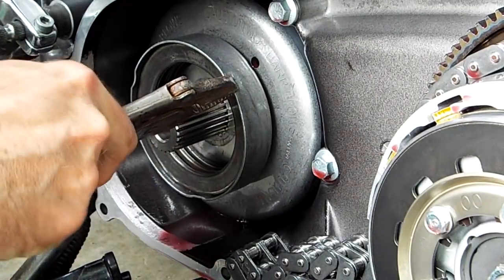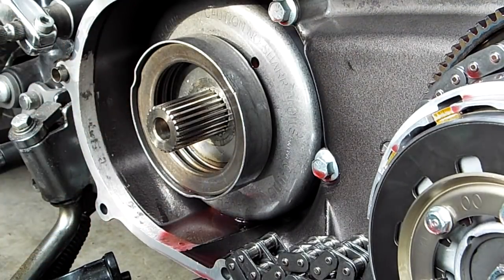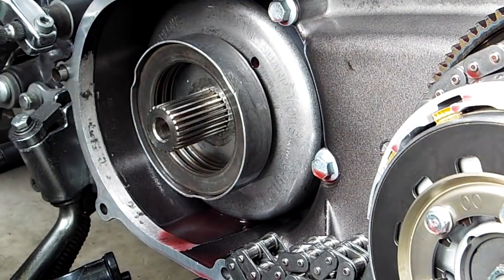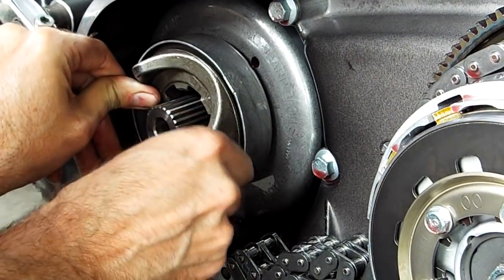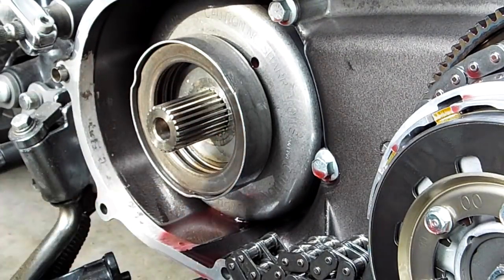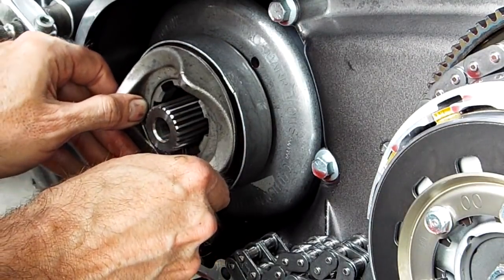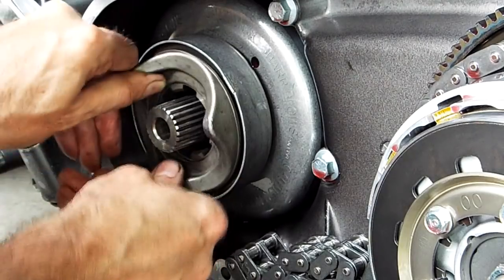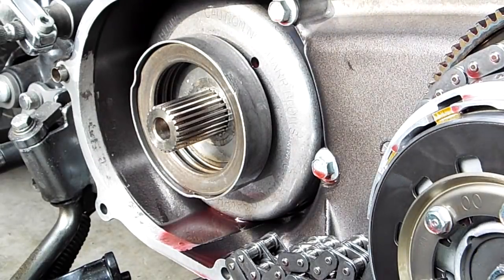And it's just to hold the springs in when the compensator is apart, generally, these tabs. Because once the compensator is together, this is going to be pushing right up against the pack of spring washers in there. So what I'm hoping is that I've got a shim now instead of a spring. So I've got four springs and a shim instead of five springs, if that makes any sense. That's what I'm going to try. So let's go ahead and get this thing back together. Where are all the parts and pieces?